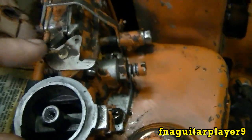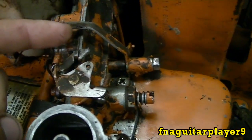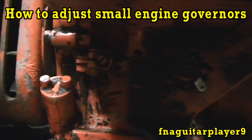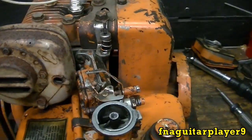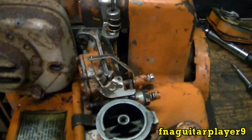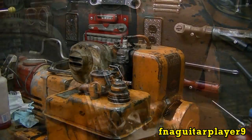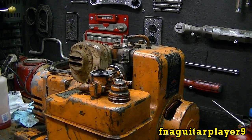I got a little side note on this — when you saw it before I started, the linkage was hooked in wrong and it was working backwards. I hooked it over here where it's supposed to be and adjusted the governor by turning the adjustment screws on there. I also had to bend the linkage where the spring hooks to it to tune it. You got to bend that to shorten or lengthen the spring to get the RPM adjusted right. It's hard to get it precise on one of these, but I got it pretty close — it's putting out 120 volts and it sounds about right, so it should be close enough for what you're going to be using it for. I got everything put back together, got the linkage freed up, and we'll see if it's gonna start.